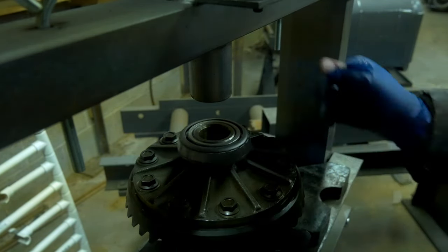And while this thing is wet, you want to try to not move it around that much. Put all the bolts in where they're supposed to go. They do have lock washers with them. And then I just take a socket with my fingers and snug it up. It's not even compressing that lock washer all the way down. Just go around in a star pattern and then wait an entire night.